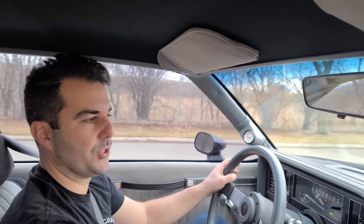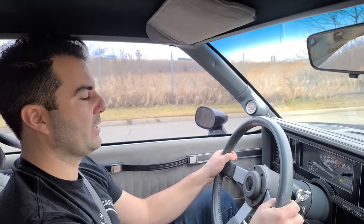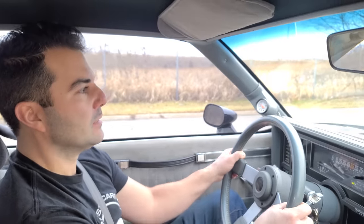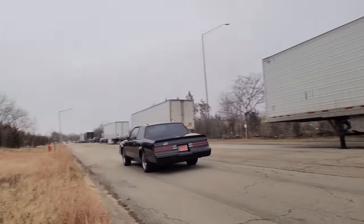At the end of the last video we had some performance issues — the AFR went really rich and we had less boost. This was caused by a vacuum line that had come undone and was kind of hacked together, so we're definitely going to fix that. Right now we're essentially back to stock power, running a little lower boost than factory. Taking it for a quick listen from outside — the boost kicks in eventually and it feels okay, but it's not doing anything dramatic. We need to do a lot better.